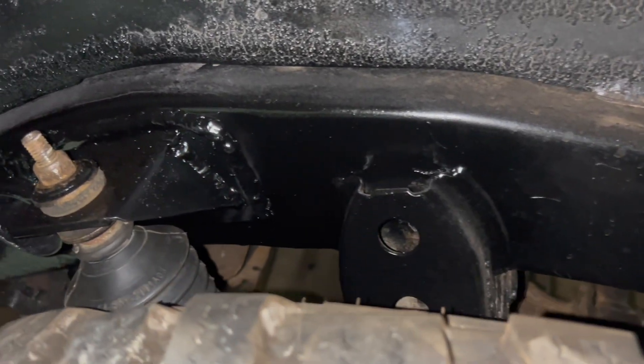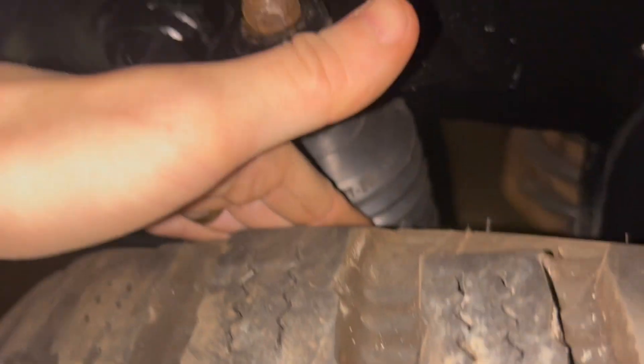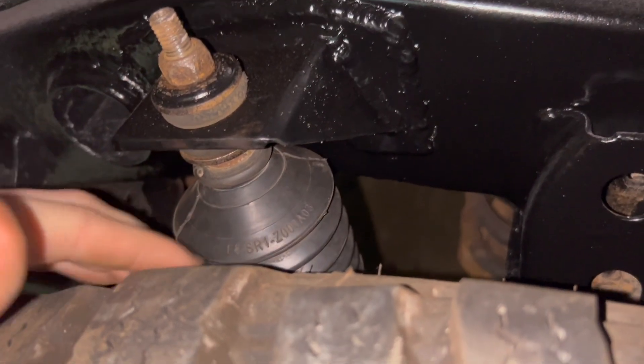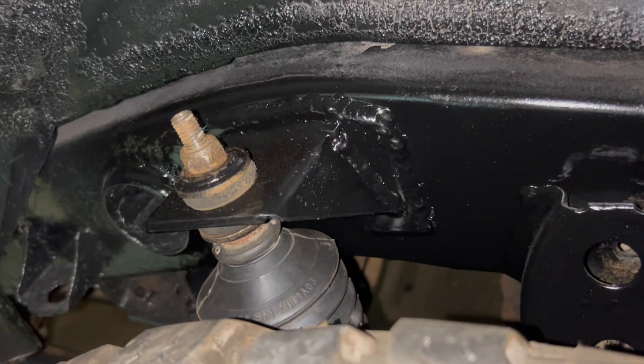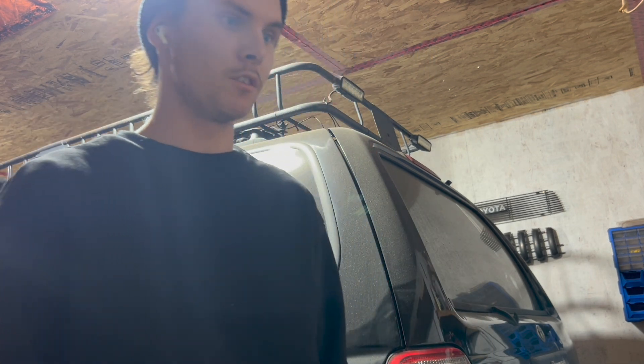Job is finished. The shock boot is a little bit close to the tire — I can still fit my hand in between, and there's plenty of space between the tire and the actual shaft. I still think I'll probably end up running spacers until I get a new set of wheels with a better offset. Honestly, not too bad of a job. The hardest part was just getting the rear shocks out of the original location. It's a great mod for the cost — it's really just a few dollars in steel, and if you have a welder and the tiniest amount of fabrication skills, it's a relatively easy modification.